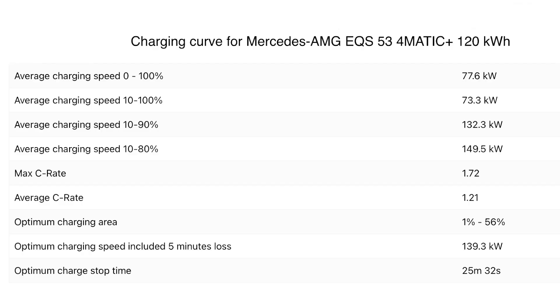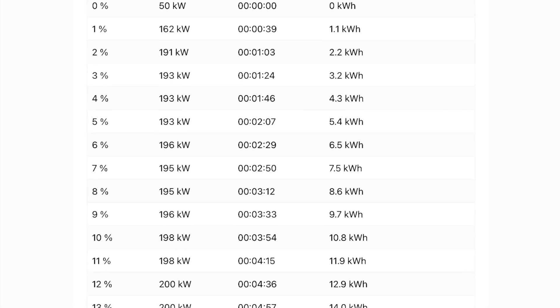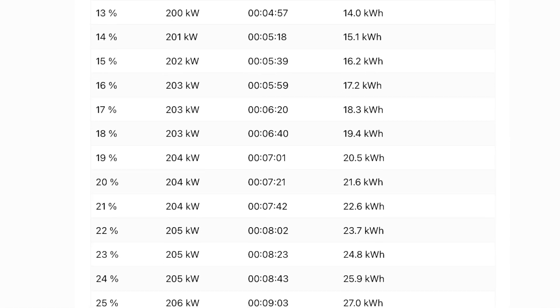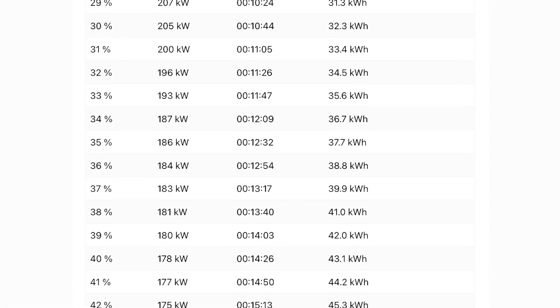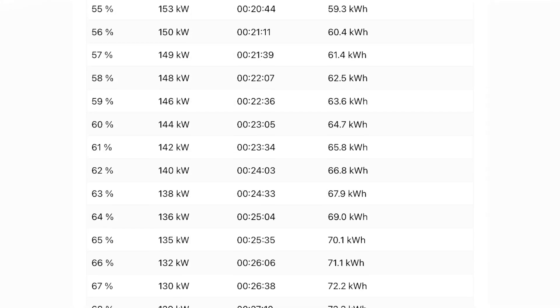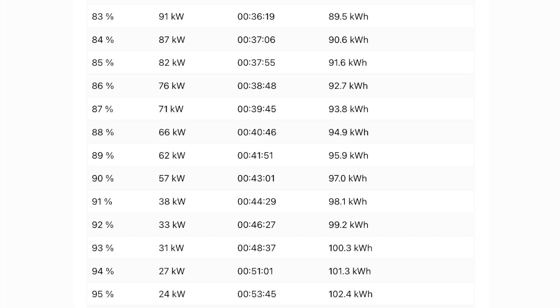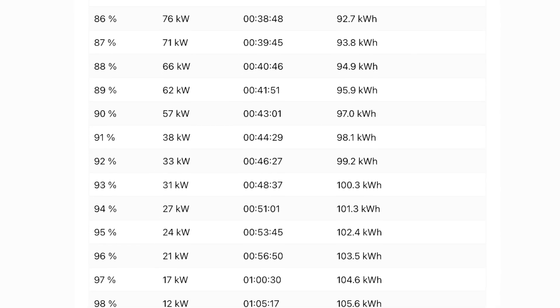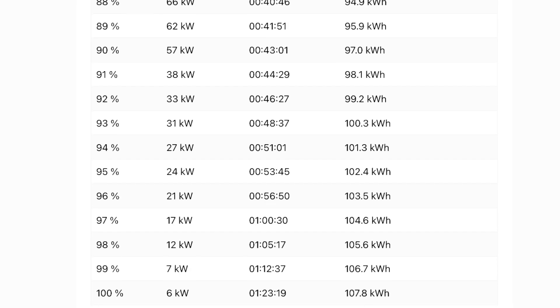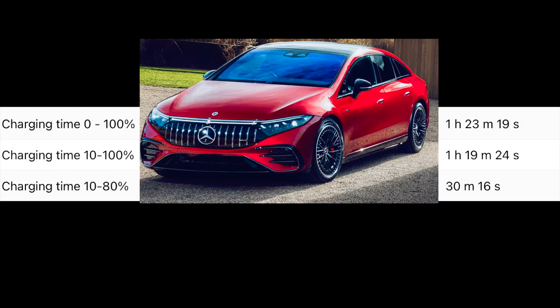For the optimal charging time, you want to plug in at about 12%. You're going to get 200 kilowatts and you'll hold that all the way until 29%, which is 207 kW. At 29% it drops off a bit, but stays fairly high — at 40% you're at 178, at 50% you're still at 162, at 70% it goes down to 126, then at 80% it's at 100 kilowatts, then 66 at 88%, and after 90% it drops to 38.